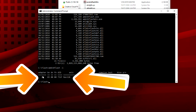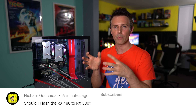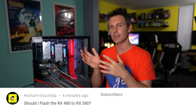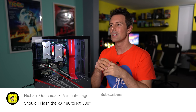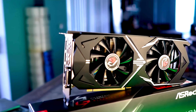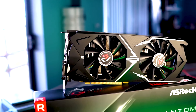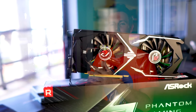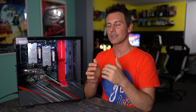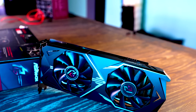Sometimes it'll work but won't work properly — once you load up games you may get flickering, meaning the GPU core or memory on that RX 480 just aren't up to the task of running at RX 580 speeds. So it is a gamble. If you're well-versed in custom GPU flashing and know how to flash back if something goes wrong, you can definitely try it. But if you don't know what you're doing or it's your first time flashing, I would advise against it.